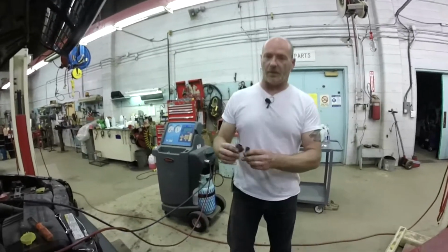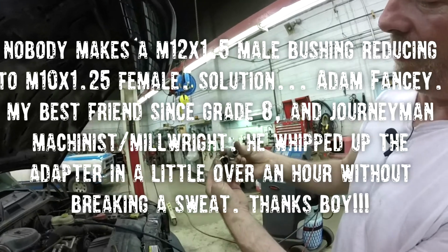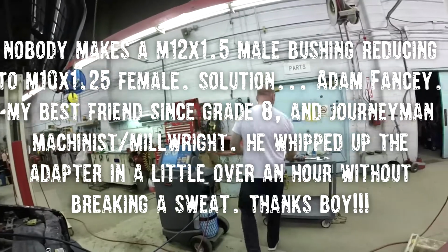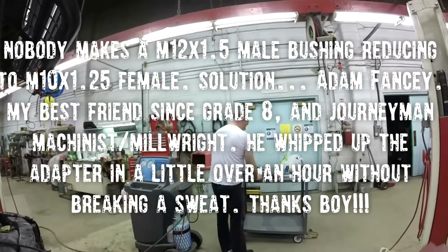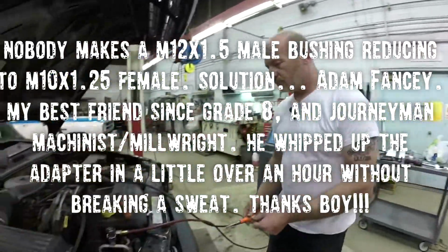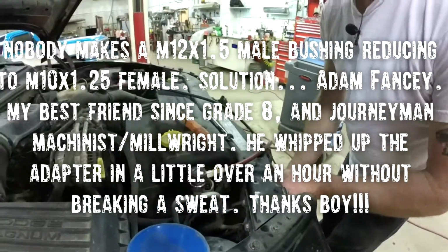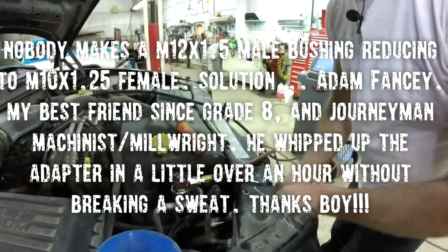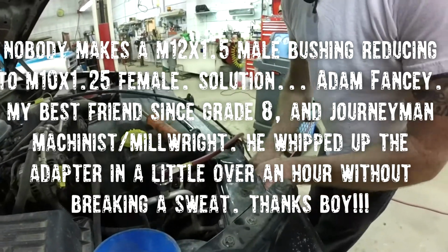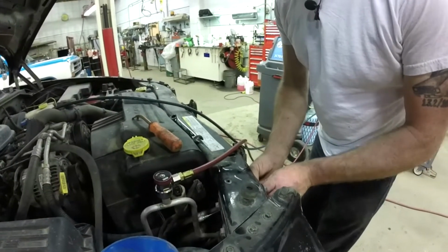See, and there's our issue right there. We've got new wires a 2-wire, old wires a 3-wire. And you can see the size difference, and that's what our adapter is for. So all we do is take it out like a tire valve stem. That's it, that's all. Whole reason why the Schrader valve is in there is just so you can service that sensor without disabling the AC.